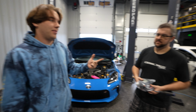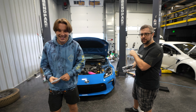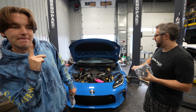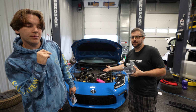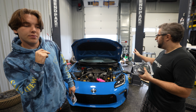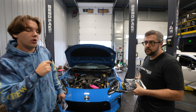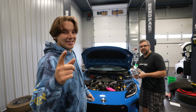What's the first step? First step is you got to take your hammer and disconnect your fuel pump assembly. Why do you disconnect the fuel pump assembly? So on a lot of cars, you can just pull the fuel pump fuse. Problem is, I don't know which fuse is the fuel pump fuse. So what I've done is unbolted the rear seat bottom behind the driver's seat, and we're just gonna go straight into the fuel pump hanger and disconnect it and try to start the car. Oh, I see. Yeah, we just want to not have pressure in these lines. Dave likes drip, not spray.